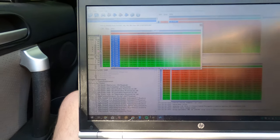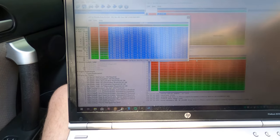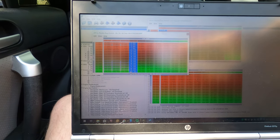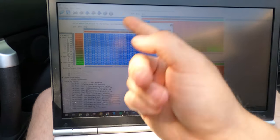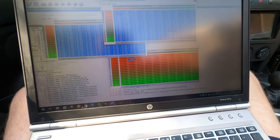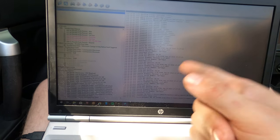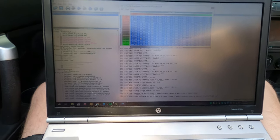Okay, let's copy these. Is copy still Control C here? Yes, it is. And then paste to all other. Oh, it just pasted it to the first one. I've got to do these individually. Oh well. Paste, paste, paste. And now that I have that entire table for fourth, fifth, and sixth gear normalized to be 1-to-1, I'm going to go over to my second gear. I'm going to paste that in here and boop. Boop. Yes, numbers mean numbers now. So now I have a 1-to-1 throttle and a disabled fuel cutoff. Oh, and did I not change first gear? Oh, paste. They are all fixed.